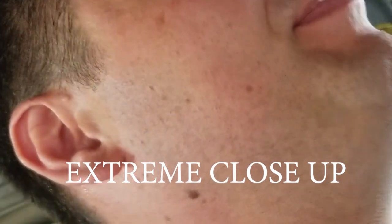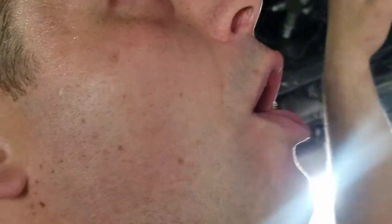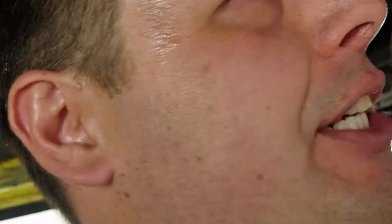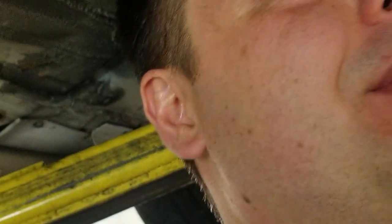So the biggest problem with this is because this has a steel plate clutch. The advantage of having a steel plate clutch in the transmission is that it almost never wears out, but it's super noisy and it does not slip. It's either on or off, and you have to rev the shit out of this. Which for a track car, I mean, who cares? You're tracking it, but if you want to drive this in the day, it's not a good idea. So if I was trying to sell this to someone who plans on driving on the road, I'd probably get rid of the clutch.